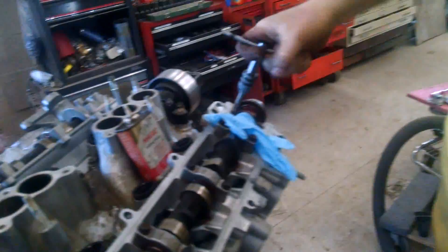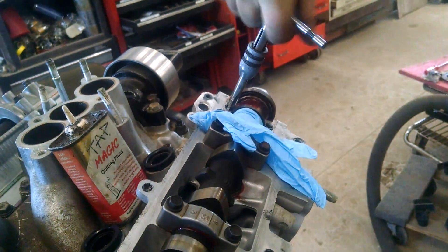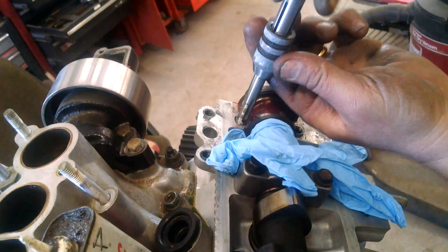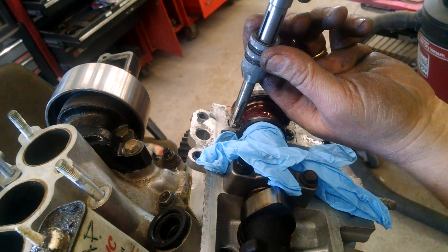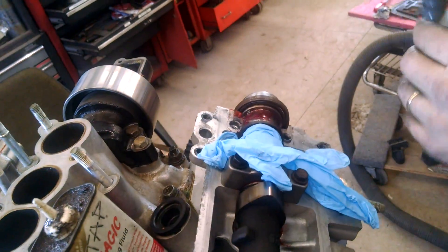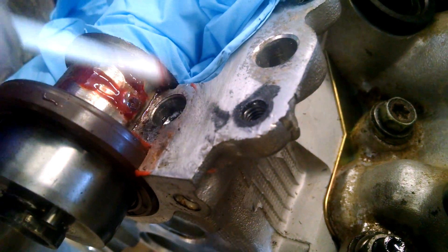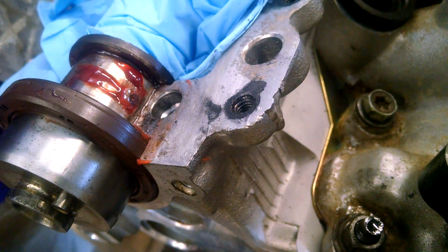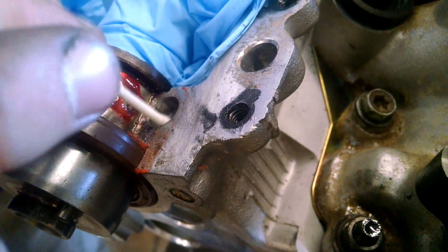Now I'll back out and vacuum. After you tap this out you'll want to clean up all the little chips of aluminum. We were using a Q-tip because we had them handy — they seem to grab the metal real nice. You want that to be awfully clean when you're all done. It's got to be pretty much perfect.